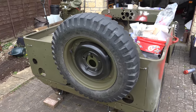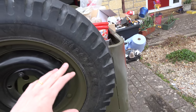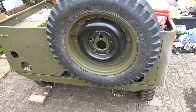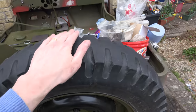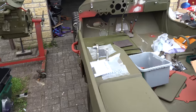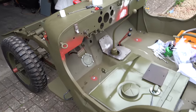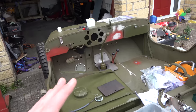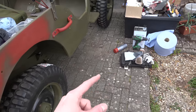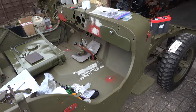On the rear we've got an original World War II Firestone tyre. This is interesting - it's made in England, so I think it's lend-lease or manufactured in the UK, which is pretty cool. Goes with it being a UK Jeep. So we've got the used, part-worn original tyre on the rear. Coming around - fuel tank's in, all mostly plumbed in. Original handles on there. Transmission and transfer case went in fine. I used a transmission jack like I did on the GPW - put it on the side, roll it underneath, crank it up, and bolt on the transmission and transfer case. That was nice and straightforward.